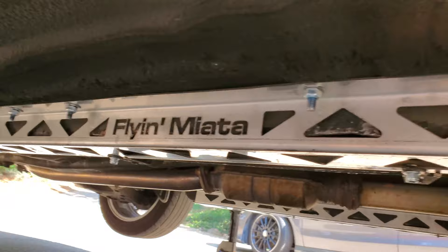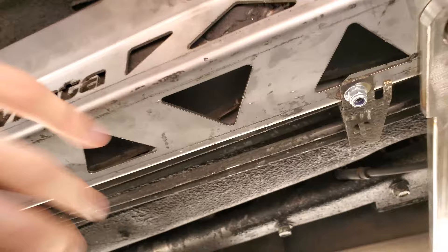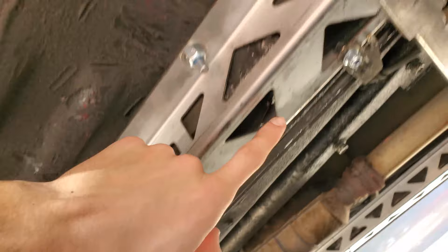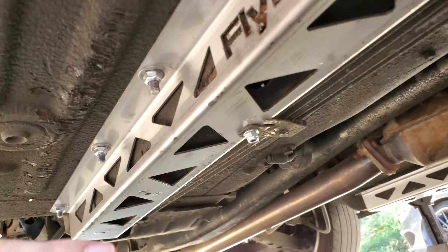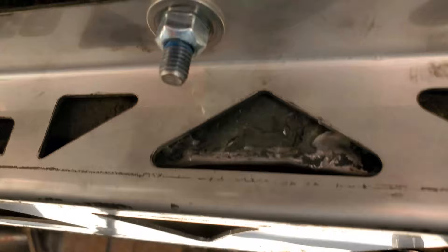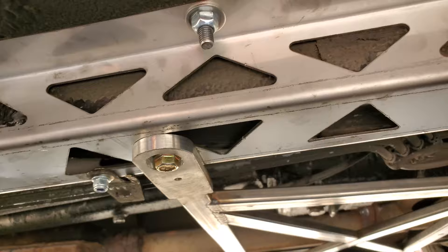The passenger side is finally done. Because of the mushroomed frame rail I couldn't get it all the way on at first — what worked was putting a longer bolt through the bottom, tightening from the top, which pulled the rail against the chassis and allowed me to do up the rest progressively. I did loctite these bolts, but not the bolts for the crossmember, since you'd want to remove that easily when servicing the car. The driver's side will be a repeat but without the fuel and brake lines, so it'll be much easier.